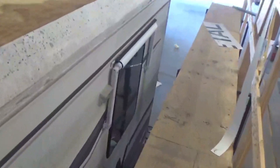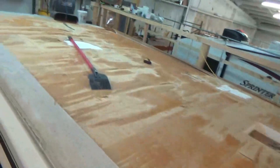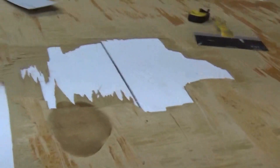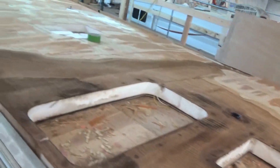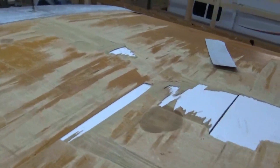That's the same one we just did the back wall on — they're stitching that back together over there. This is our Winnebago. All right, we got all that rotted roof off. You can see we got the ply foam showing. We got all this dry down here, got it mold-killed. What we're going to do now, we're just staging right here — we're going to re-deck this roof. We cleaned up all the loose stuff so that'll lay better, and we'll be back with more once we get this roof deck glued down.